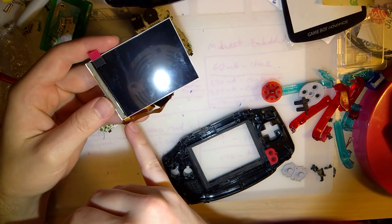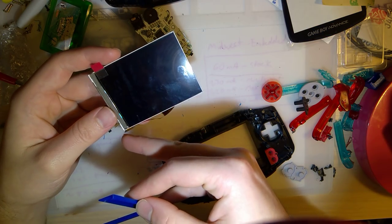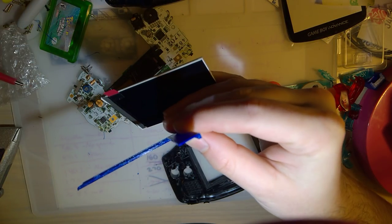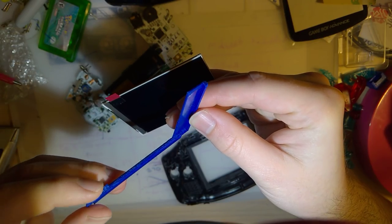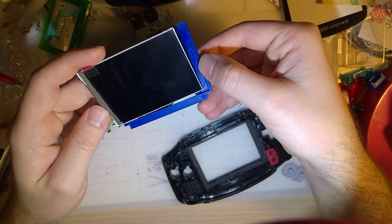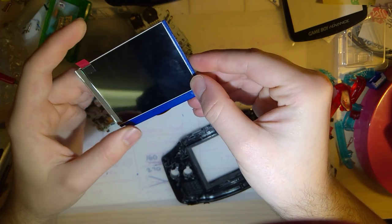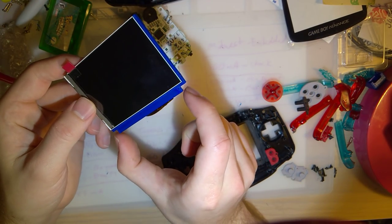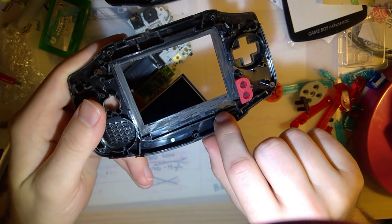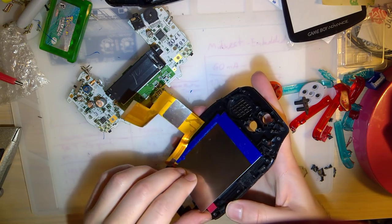If you're looking at the screen with the connector on the bottom left, the bracket has an inside angle that goes on the corner of the screen. It sticks in place and the purpose is to line up the bottom parts with the part you should not have removed down in the shell. This will help center the screen properly.